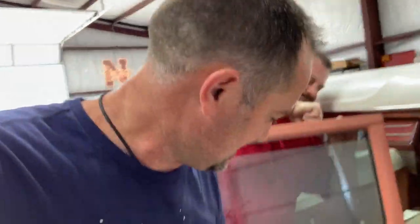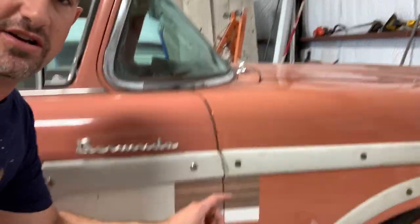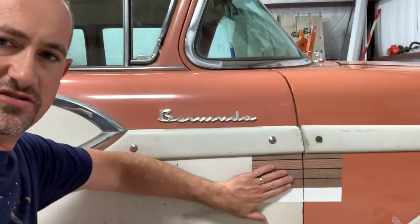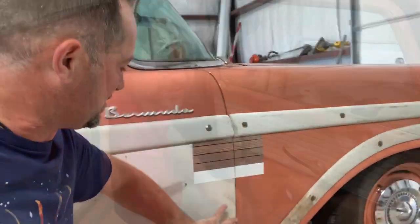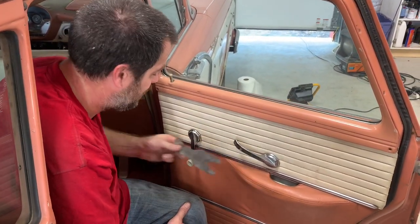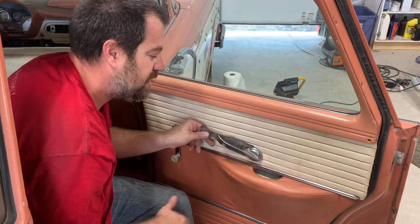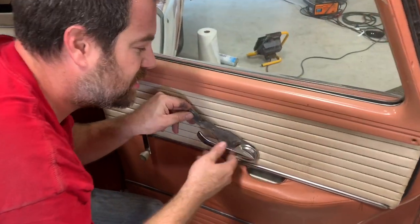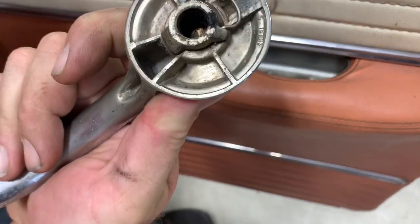He's removing the door panel because there is a crease in the door — just a little crease — and we're going to push that out and fix it up before we put the wood grain on. We stuck a little wood grain on right here just to check that it's opaque and you can't see through it, since we did repaint this fender because of some damage. This is something a lot of people have trouble with: using one of these tools to take the door handles and window cranks off. You want to get in between the little nylon gasket between this and the door panel, push it, and you should feel a pop.